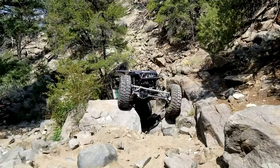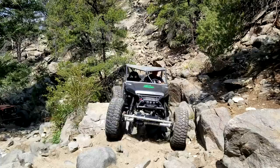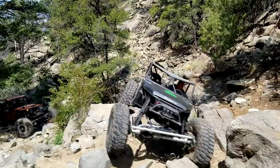And on the west side of the country, when you have a full tire, you gain just ridiculous traction in the front end, and it'll help pull you over rocks. I like to run mine half because I'll wheel anywhere in the country, and when you have a half full tire and you have to use that tire spin and get that momentum, that fluid kind of works its way around the edges and I can still bounce up the rocks when I need to, and it's not so hard on my drivetrain parts.